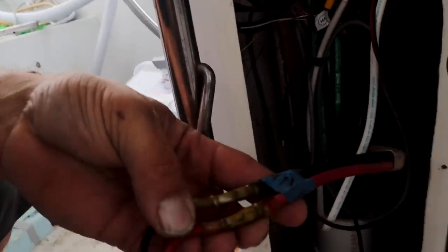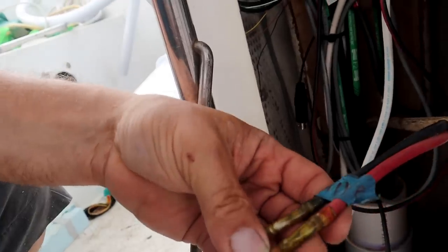I'm replacing all of that with new wire, so I'm going to have to try to find a connector — hopefully one where I can connect 8-gauge wire directly to one of those small connectors, which I don't know if I can do. I may have to go to a terminal block to make that change, because crimping two different diameters of wire together is not a good idea unless you have a crimp connector designed for it. Using a big 8-gauge connector and trying to fit it around a wire half the size just doesn't work.